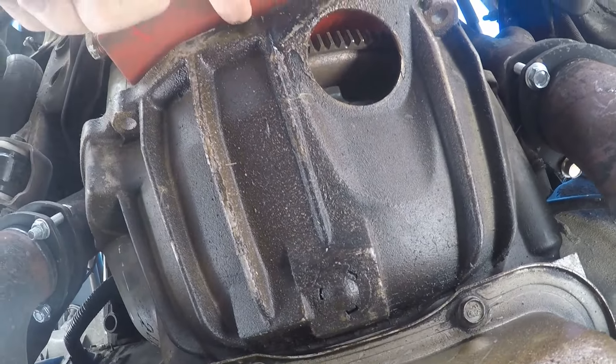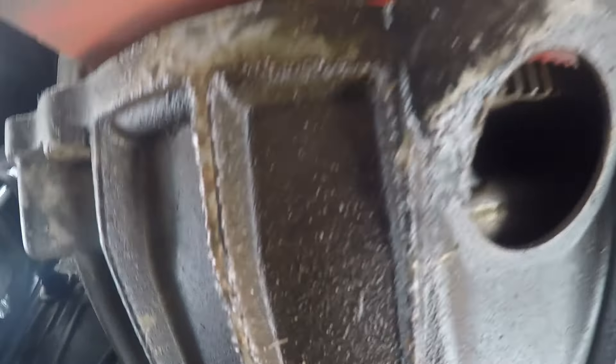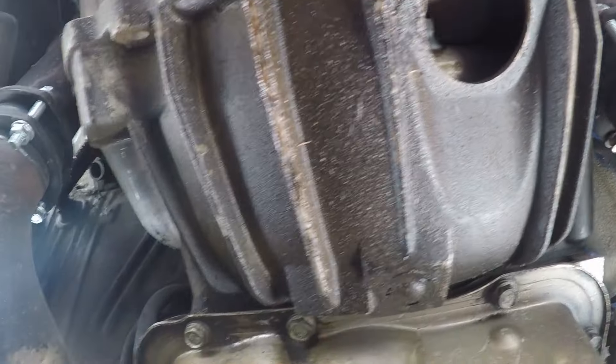It's wet here. It's definitely coming out from in between the bell housing and the motor. I wish there was a bigger inspection plate on these, but unfortunately there's not. The converter's tight, everything looks good in there. Like I said, we're gonna tear this thing down a little bit further and go from there.